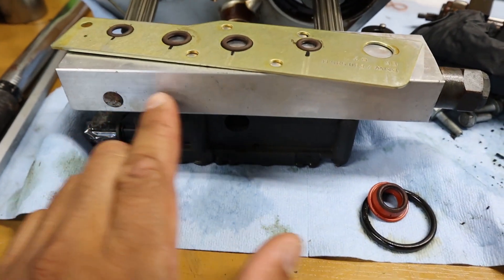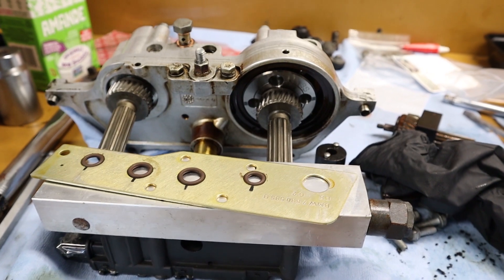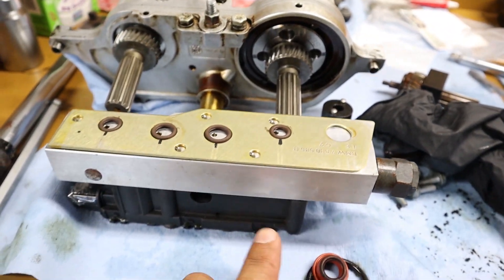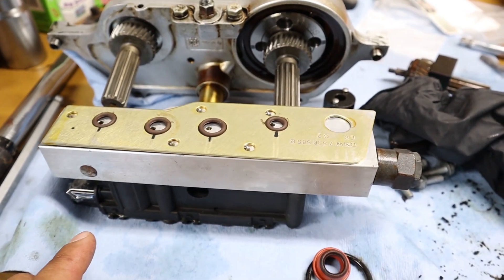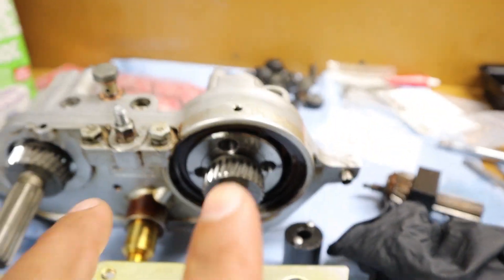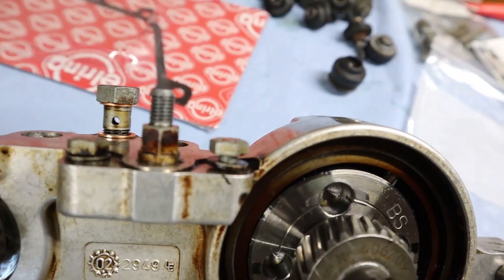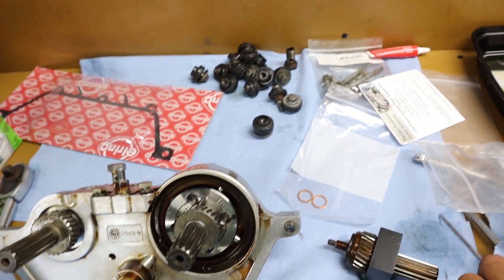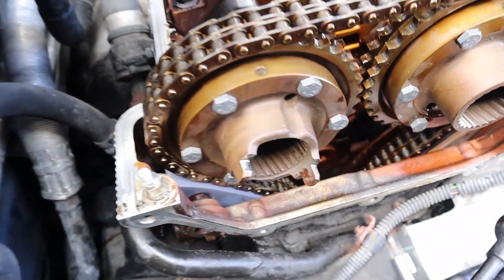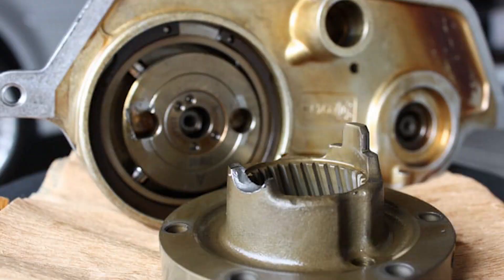This is just a valve body. The high pressure oil generated from this pump gets sent to a reservoir on the side of the motor. There are four ports in this valve body and four magnetically actuated valves. On the exhaust side it has the high pressure pump, and this is where you see the two teeth that often break on E46 M3s. Since there's so much free room, the ears on that pump disc actually end up smacking against the side of that hole, and sometimes, depending on how bad it gets, it will actually shear those teeth off.